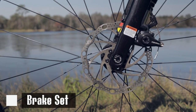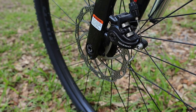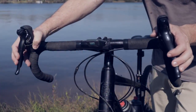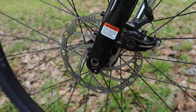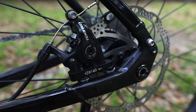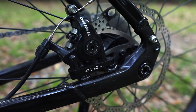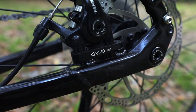Now let's look at the brake set. This build comes with mechanical cable-actuated disc brakes — Tektro MDC 550 brakes with 160mm rotors, integrated into the Shimano Sora levers. Mechanical brakes require you to be a little more aggressive with the lever, but I still prefer disc brakes over rim brakes any day. They're flat-mounted, so you can easily upgrade to 180mm rotors for more stopping power — which I'm probably going to do since I plan to use this bike for bikepacking.